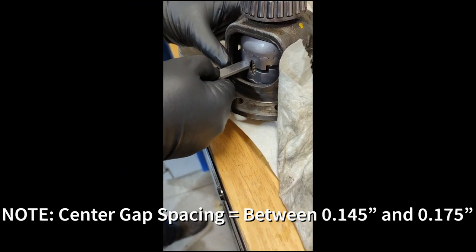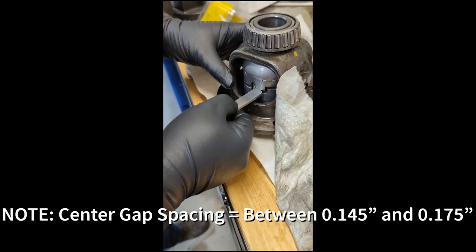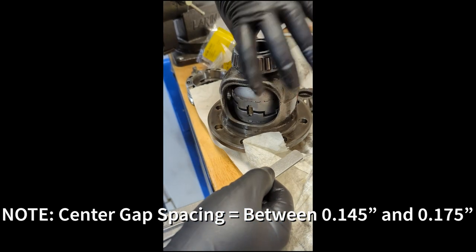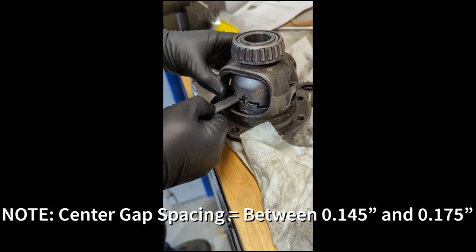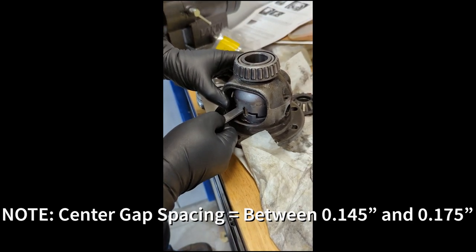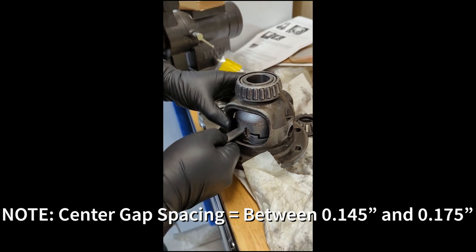So here's 161 — it's a good snug fit. Tried it on the other side: 161, good snug fit. I tried to add two thousandths more and it was too tight — it wouldn't fit. So it is 0.161 inches.